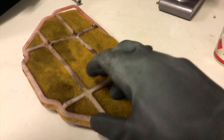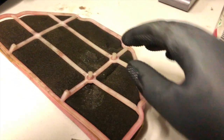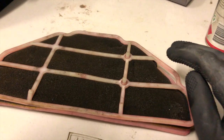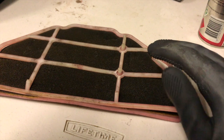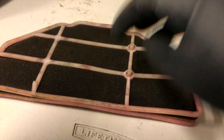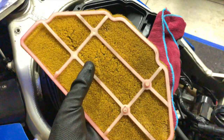This filter has a little bit of plastic restraint around the foam, so I'm going to take that off. I've sprayed a little bit of degreaser on there as well and will give it a good wash afterwards. All you do is basically dip it into warm water with a little bit of foam detergent, or if you have an air filter cleaner use that. I just used degreaser — I wanted to get all that grease out of it.